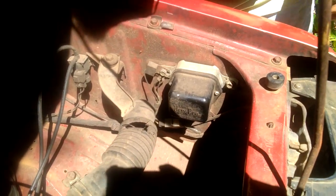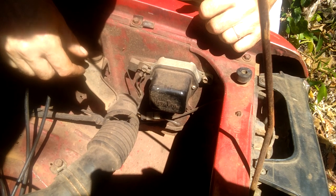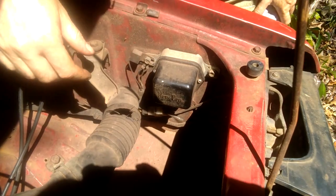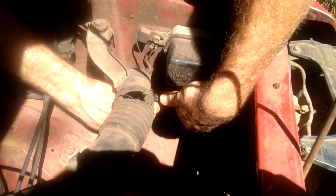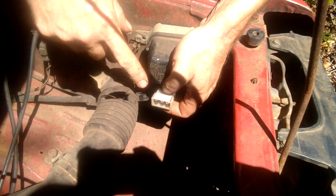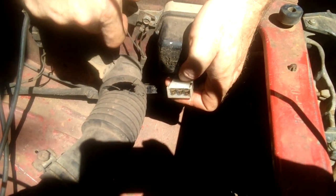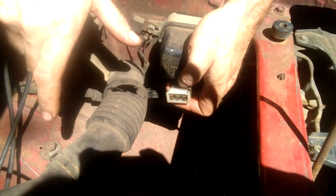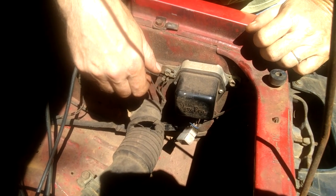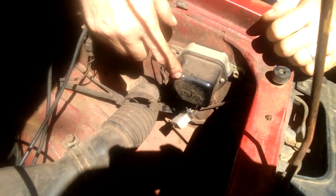This is a video on how to adjust a New Era style voltage regulator — apparently the only brand of mechanical voltage regulator available in the Philippines. This is different from the American style mechanical voltage regulator you might have on an old Camaro or Mustang from the 1960s, because this one has six wires instead of just four. The American version also has an adjusting screw to set voltage up or down, but this one does not. The problem with these New Era regulators is they tend to charge at about 15.5 or 16 volts out of the box and are not adjustable.